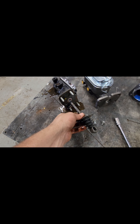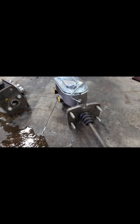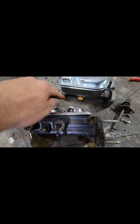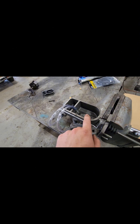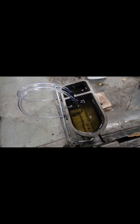With the old master cylinder out, we removed the original push pin — we have to reuse that in the new master cylinder. We also had to remove the mounting studs. The brake lines are actually the same size as your original. We set up the master cylinder on a vise to bench bleed it. You can probably see the bubbles coming out as I push the pin in.